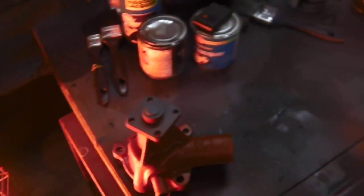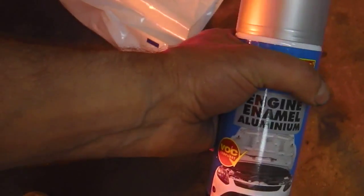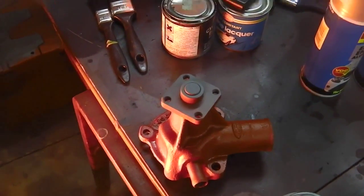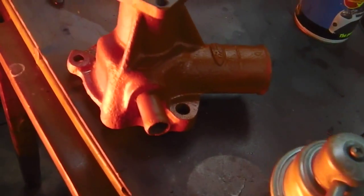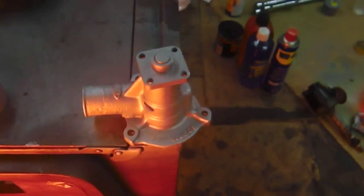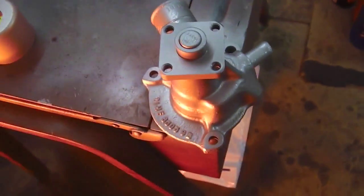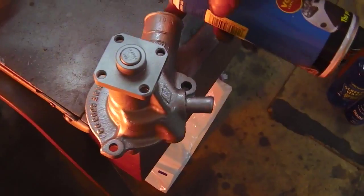Let's just see how this red oxide is going off now - it's drying under the infrared. We've got this petrol resistant lacquer which seems to be pretty good stuff, and we're going to pop on some engine enamel. I'm just going to experiment with different finishes before I finally apply it to this pump - see what looks good on a trial piece of metal first. So let's get that red oxide cured and then we'll get the silver and the lacquer on. Putting down the engine enamel paint to finish off over the red oxide and zinc.